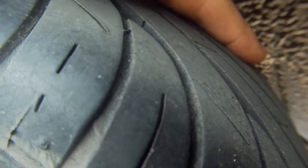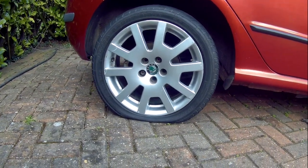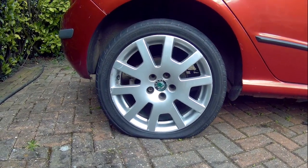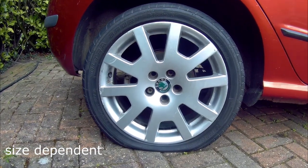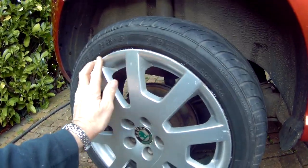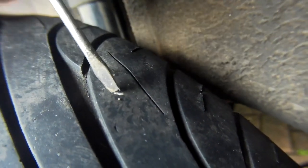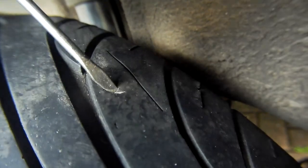If there is, then taking these out will often cause the tyre to quickly flat, locating the problem. If this is then in the middle section of the tyre, it can easily be safely repaired, but not if it's located on or near the outside edge or, of course, the sidewall. Also, take out any stone and flint debris with a small screwdriver.